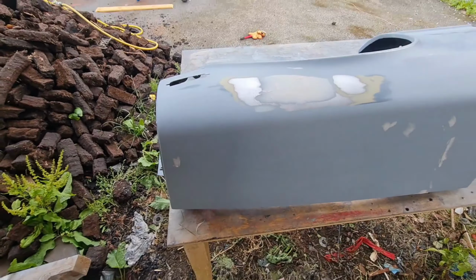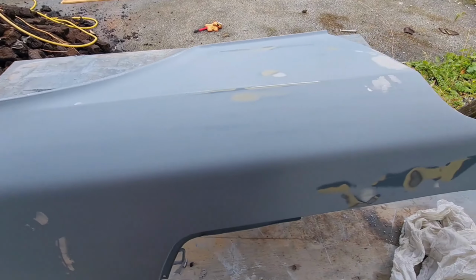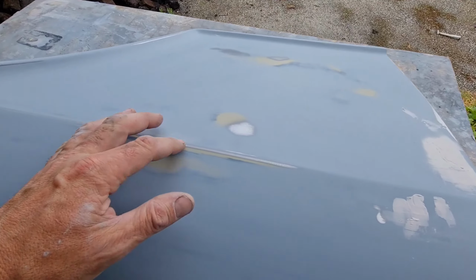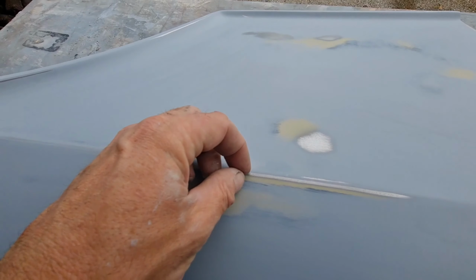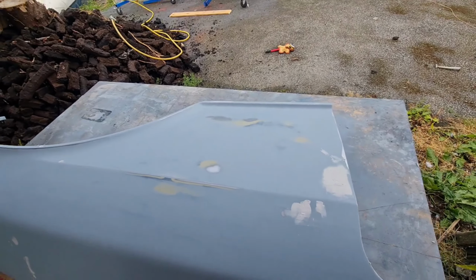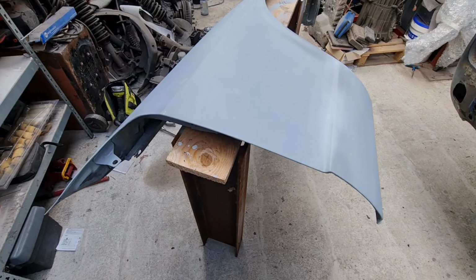And I think at this stage I want to just get a wing that I can look at with the paint on it, just to see how it came out. But overall everywhere else came out good, so I'm going to leave that putty set for a while, and you see all kinds of defects when you get in close. Yeah, there's a bit of putty there as well. But yeah, we'll let this set and we'll sand it, and then it'll be ready for another layer of prime. And hopefully at that stage then it's just a matter of wet sanding it, getting ready for the paint.